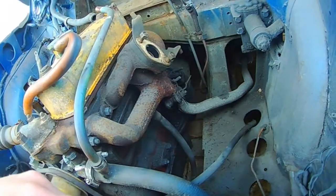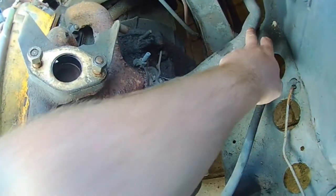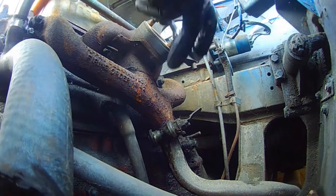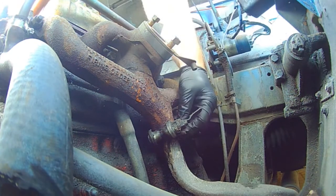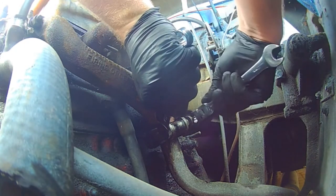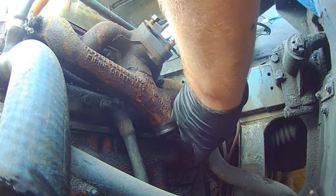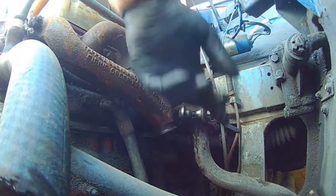Now that the carb's out of the way, you can see the room I've got to work — it would have been a bit fiddly getting under here, but it just makes it easier. I need to disconnect the downpipe of the exhaust from the manifold, but you can see under here it's quite rotten — a lot of rust. A couple of bolts, one here, one here. Got a bit of string to hold it against the bracket here to stop it catching the engine when it finally goes.